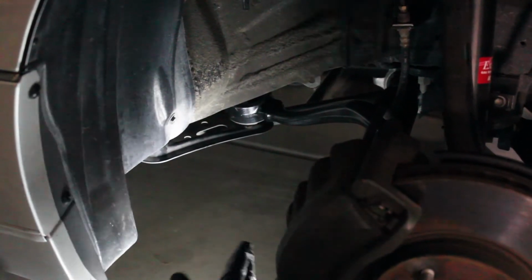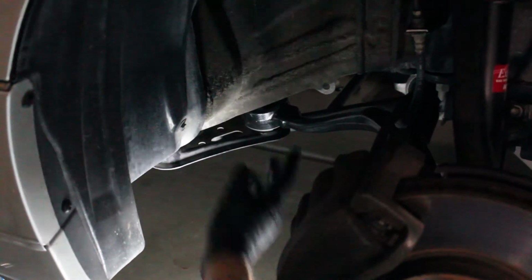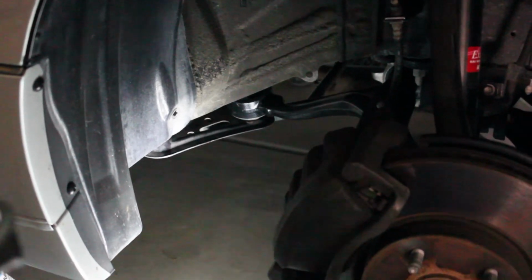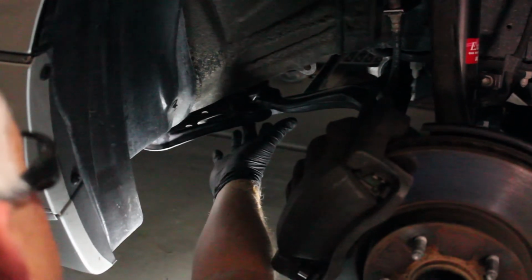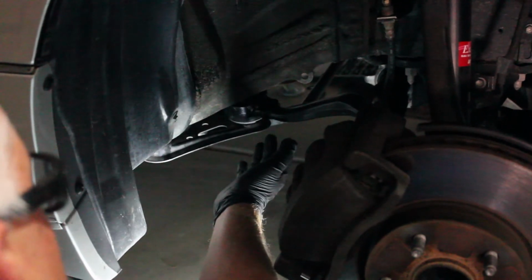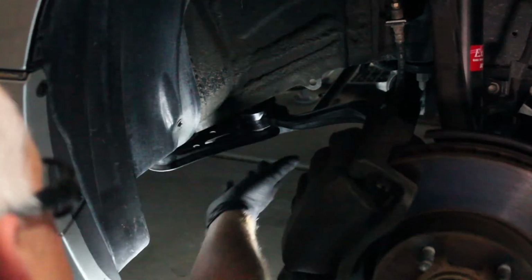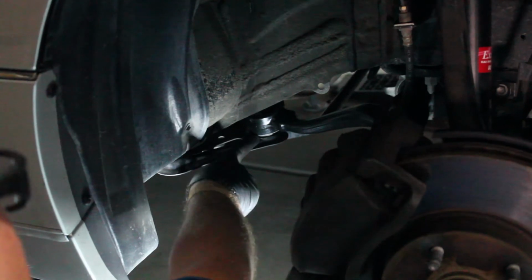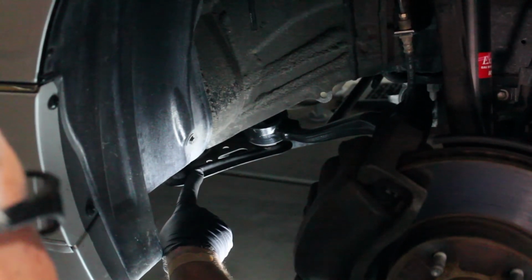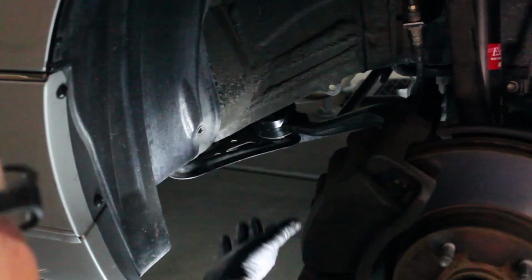At this point, what we've done is, as we had stated earlier, one person used a crescent wrench to adjust this so I could get the two bolts in. Got them in and tightened down to 122 foot-pounds. This one, this nut here, is going to be 112. I actually put this plate back on, but I haven't reconnected the crossbar yet. All I've done is put one bolt in to hold it into place, and then the nut that goes on here. This gets 112 foot-pounds. Each of these nuts and bolts get about 43 foot-pounds. So I'll do those on both sides because I have the whole bar, the X-brace loose now.